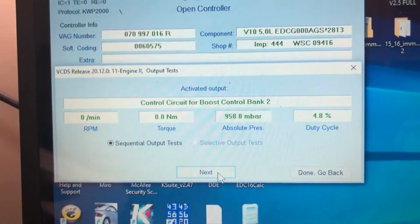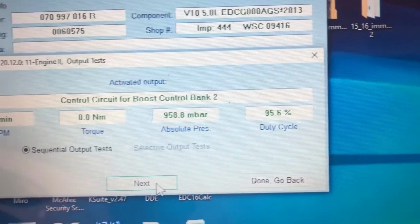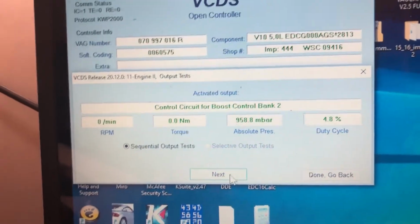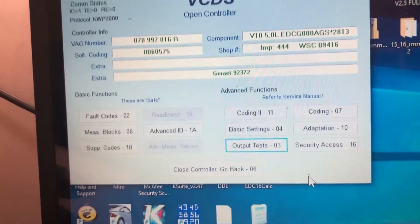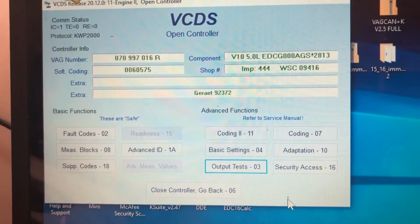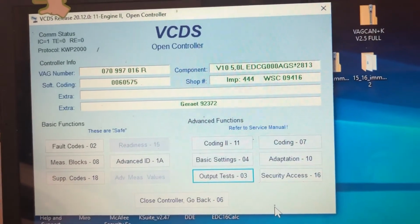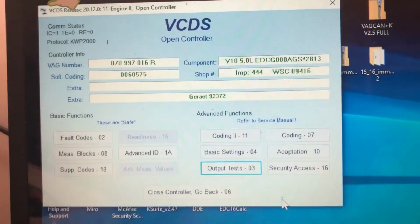And this would probably be a good time to say, about a year ago when I was tuning my green one, I did a deep idle mod. So basically at idle, the vanes are at about 95%. So that's all the way closed, so you hear a lot of turbo noise. Deep idle mod, a lot of the 4-cylinder TDI guys will do it. It'll open the vanes up so you hear more of the engine and not just a turbo whistle.